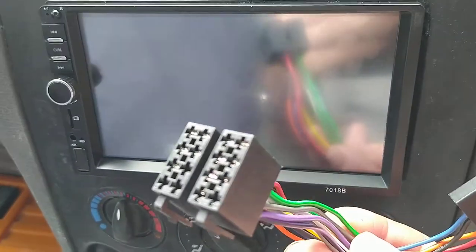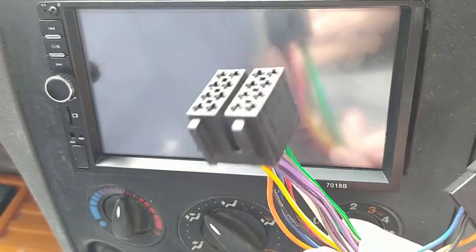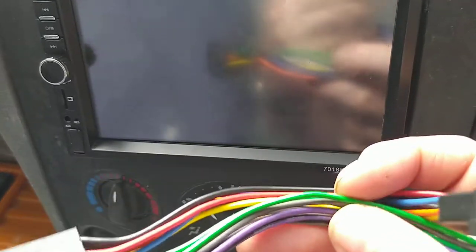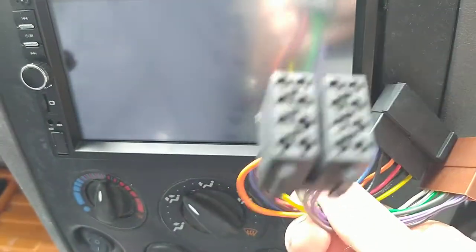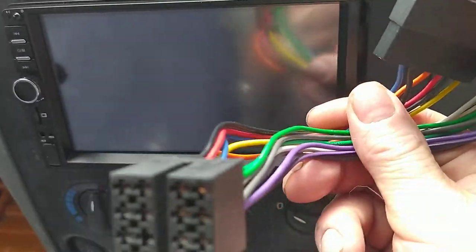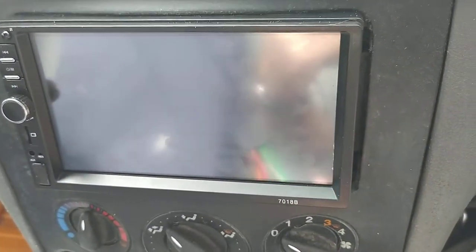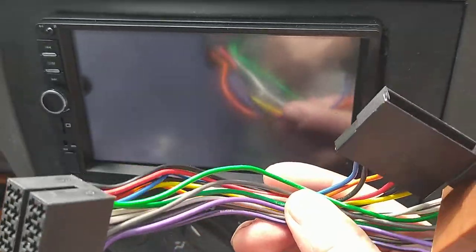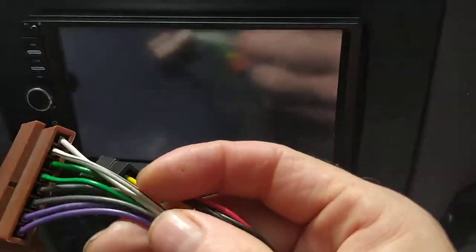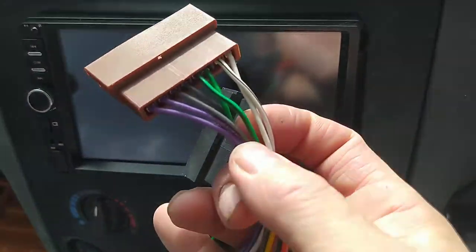There's a bit of a gap either side so I didn't bother using the cage. These stereos use standard ISO connectors. This one was off my original Pioneer CD player. They supply you with two ISO connectors and cables to wire yourself, but if you buy the correct harness — in this case a Ford to ISO connector — it just plugs straight into your original harness and into the back of the stereo. If you've got a Toyota, Volkswagen, Mitsubishi, or another brand, check Halfords or online for an ISO adapter to suit your vehicle.